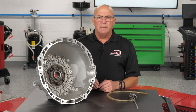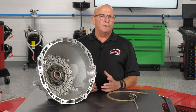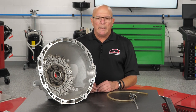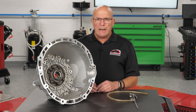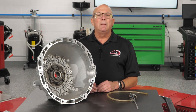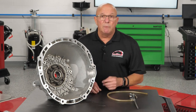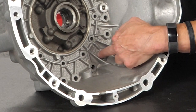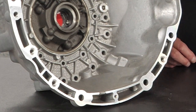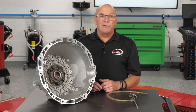A little history on this: long-time guys working on a 727 — the younger generation probably won't know it, but the old schoolers cut their teeth on it. I had a leak in one and pulled it in and out several times before one of the old timers shared a tip with me. On the 727 it happened to be a little screw at the bottom that holds in the servo lever arm that was loose and trickling out. Had it not been for the tip, I'd have been stuck pulling it out more.